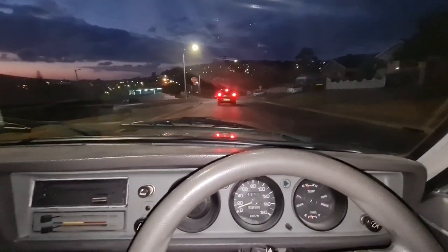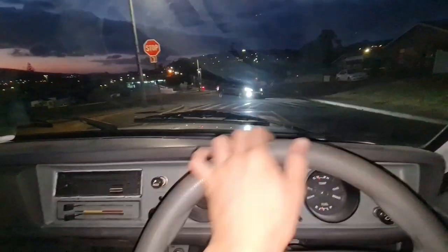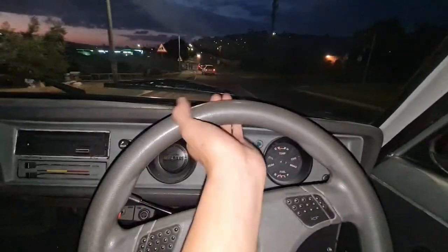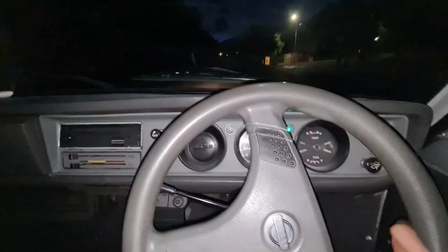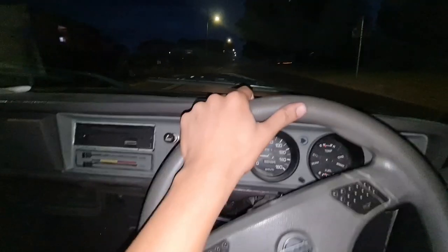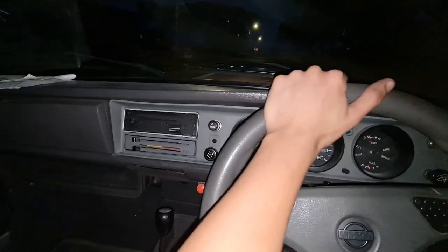I want to get a nice gap here in front of me, of this car, so I can let this car go over here quickly. I want to go over with speed, because the Bakkie speed is low, but check out that bounce. It's quite decent. I didn't really drive the Bakkie this morning, but I think the Bakkie could do with a bump stop in front, because I think the shocks in front might be bottoming out. Yeah, like that. So I think that's my only problem with the Bakkie. You see there? The shock's bottoming out, but other than that, the Bakkie actually drives very comfortable. It's only when there's a hard ditch that you feel like it's bottoming out.